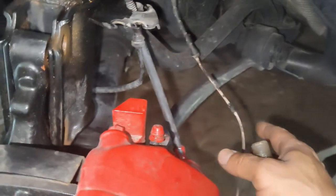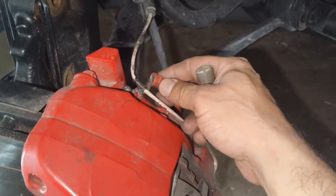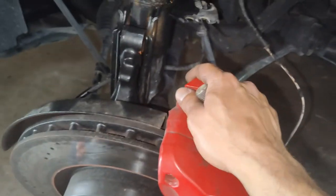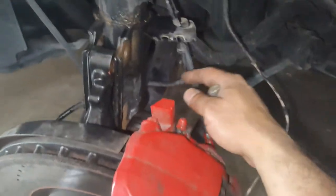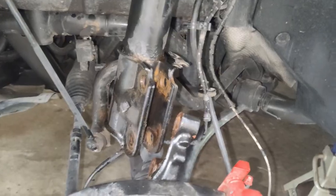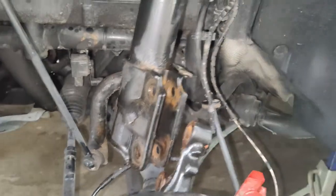There is a wire for the brake pad wear sensor that sits right in the dust cap on the caliper — go ahead and undo the dust cap and unplug it to give yourself some slack as you move the knuckle away from the strut. Make sure all hoses and cables are free from the mounts on the strut so nothing gets pulled or broken. Once the strut bolts are out, use a pry bar to separate the knuckle from the strut.